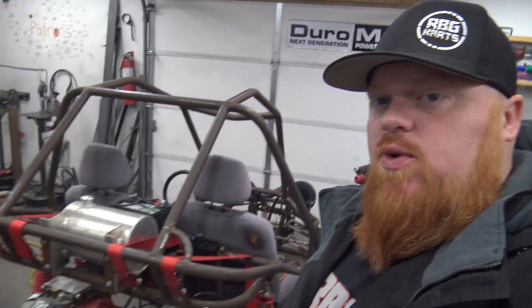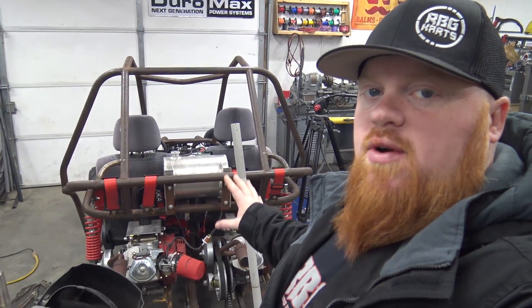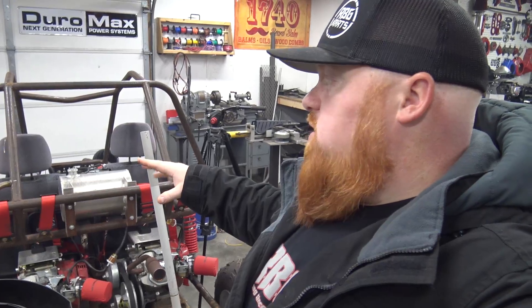Comment below and let us know what you want to see on this car. For those following the build, we messed up on the front end, so we're basically going to cut the whole front end off and completely redesign it. Since we're doing that, we have two options: we can leave the twin engines and fully build them — we have heads milled 70 thousandths, ported, Mikuni carbs, high torque cam, billet rod and flywheel — and get about 60 to 80 horsepower out of both engines together.